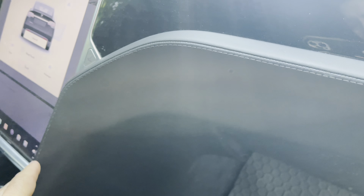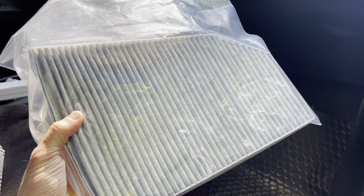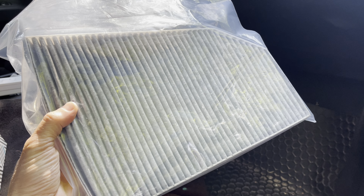I kind of started work ahead of time because this is the hardest thing to take off. If you've got this air filter, you can get it from Tesla or somewhere else. Basically it goes behind the glove box. You've got to remove the glove box, remove this big panel of trim, remove this side panel, and there's a piece underneath that you have to pull down, which is actually not that hard to do.